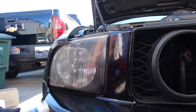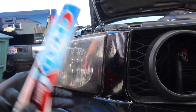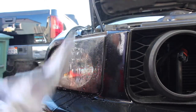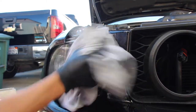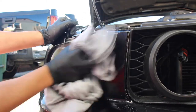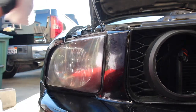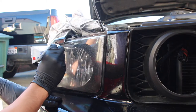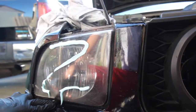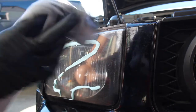First thing I'm gonna do is clear up these headlights. You can see all the fogging — I'm gonna try toothpaste to see if it works. I'm spraying it down with regular water first, cleaning off all the dirt using an old t-shirt. Once it's cleaned up, now I'm gonna use the toothpaste — just spreading it around, making a Z pattern. Gotta be careful not to let it touch the front paint job, I just got that done.